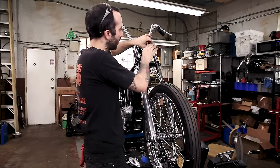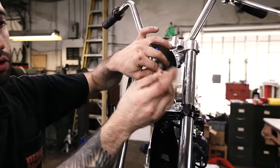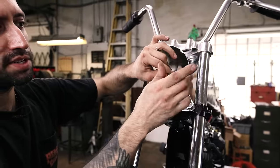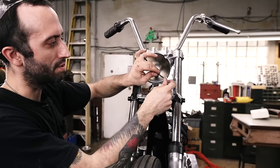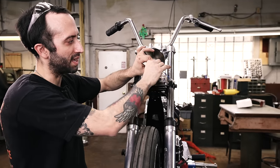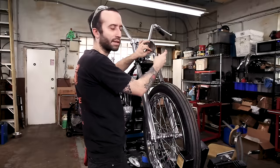So to hook up the headlight, I took the hot wire and I used a butt splice to connect the attached quick disconnect fitting to the hot wire just using a butt fitting, and then I took off the plastic and then just used some shrink wrap so it's not just this big red butt connector on there.